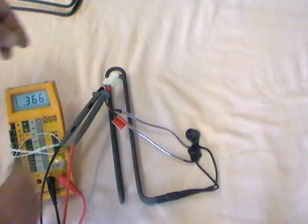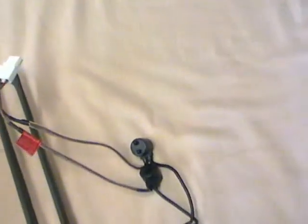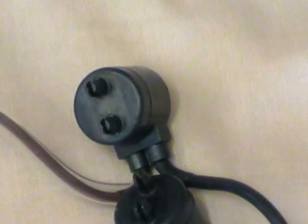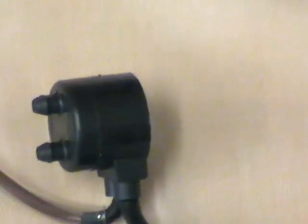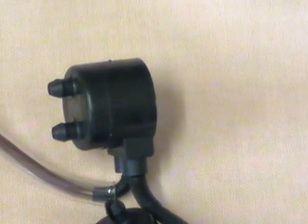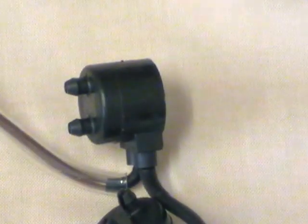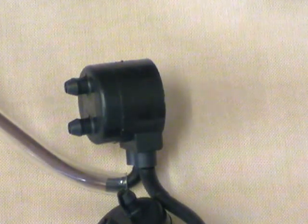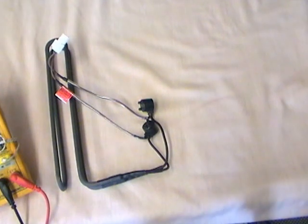Either of those fail and obviously open circuit. What's really worth noticing is how these attach. You can see on that thermal fuse it's two push-through roll plug type fittings and they go into a small hole and lock in place. So when you change this heater — the original — and you put a new one on, you can't get those to fit on the same way. The only way you can do it is to cut off those tags and tie-wrap the flat base as close as you can onto the aluminium former. Not a very good job really, but you're stuck any other way.